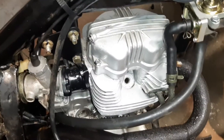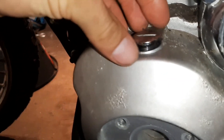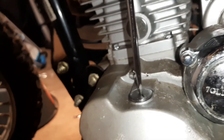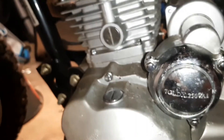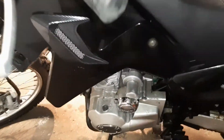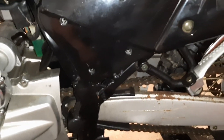Our valve adjustment is done and the valve cover is back on. All we have to do is throw that spark plug back in, put the spark plug cap back on, come over to the other side of the engine, put our caps back on — the peephole cap that let us see top dead center on the flywheel — and remember not to over-tighten that either. Now we're going to put everything back: throw that gas tank back on, hook the fuel line back up, and get everything back to the way it was. Start up the bike and see how it sounds with its new valve adjustment. Thanks for watching — I hope this helps. This bike is leaving tomorrow so I wanted to give it a good valve adjustment and oil change before it goes to its new owner.